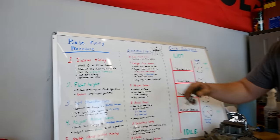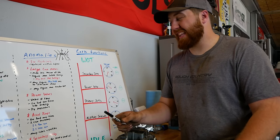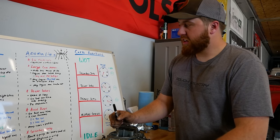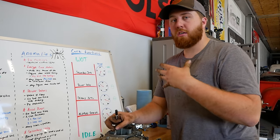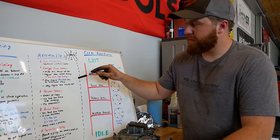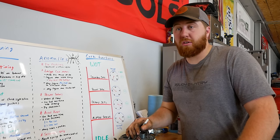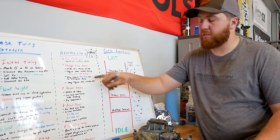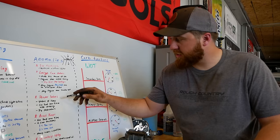You'll also have a less dense fuel charge in your cylinder — less air getting in means you need more initial timing to help burn that more efficiently. If you have a large cam or even a street cam, you're going to have to put more initial timing in. We were setting it at 8 to 15 before; you might now see 15 to 20 to get the engine to idle properly. You may also need to open your transfer slot just a touch. You can also switch to manifold vacuum instead of ported, which at idle adds timing. With that extra initial timing, you might see 60 degrees total — that's where stop bushings come in.